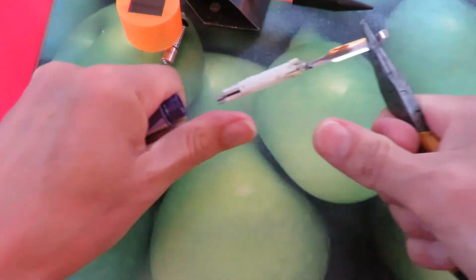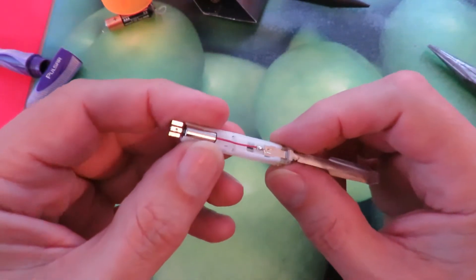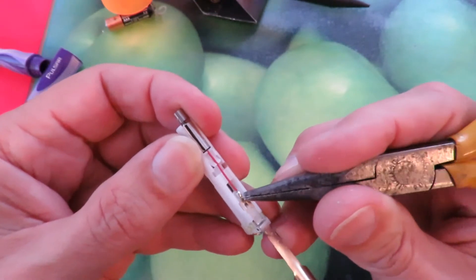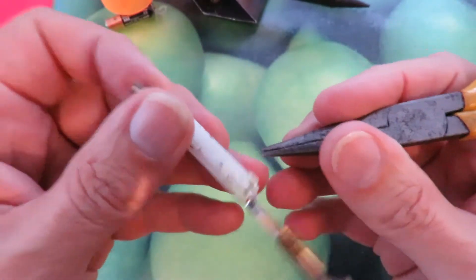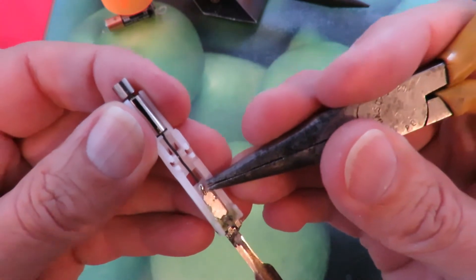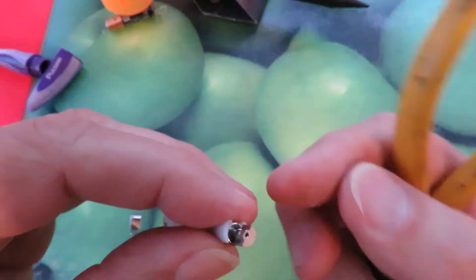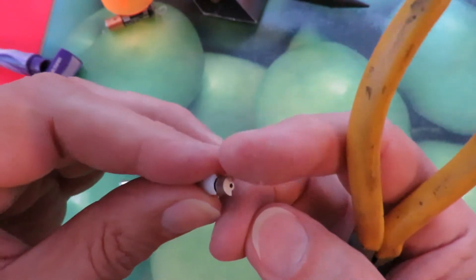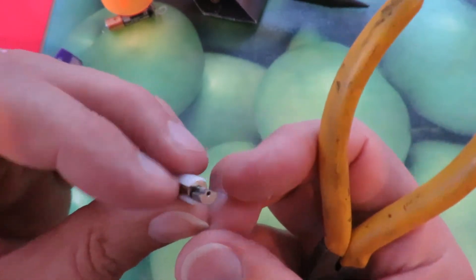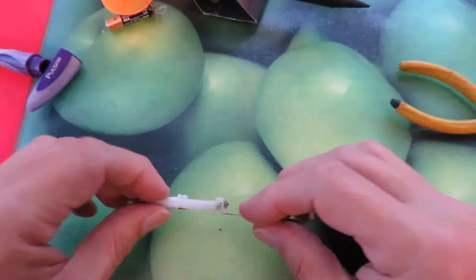I'll probably knock the camera when I do this, but I managed it. There's the vibrating motor. What you need to do is don't try and pull it out — you need to desolder it and get that bit of plastic out of the way. If you pull the wires you'll just pull them straight out of the motor and ruin it. This one has the off-center weight — asymmetric or something like that — and that's what makes it vibrate.